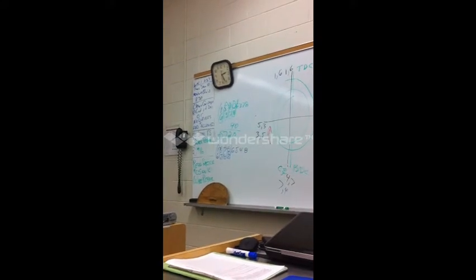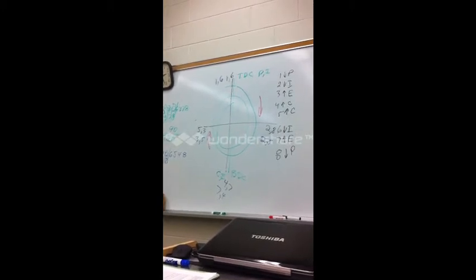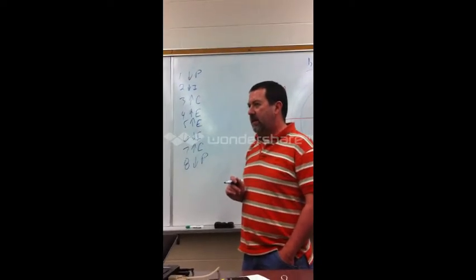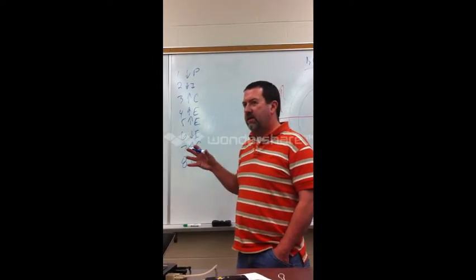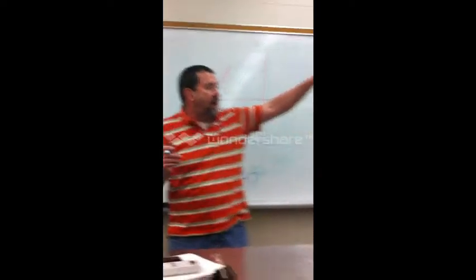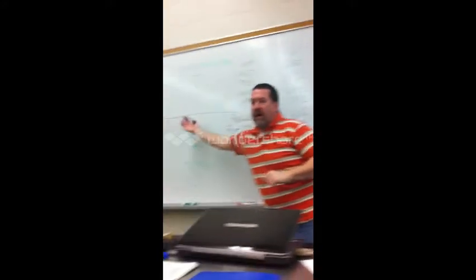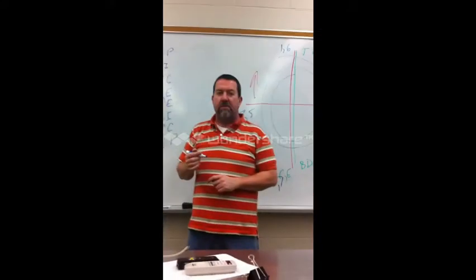Okay, so if we look at these two firing orders, they're both 5-liter Ford firing orders. What do we notice about the mating cylinders with the two firing orders? They're the same mating cylinders, right? So what determines what cylinders are mated? A component in the engine. The crankshaft determines mating cylinders. And when we're looking at that end on, we've got one and six up here, they're the mates on that crankshaft. Over here we got three and five, two and eight, four and seven down at the bottom.